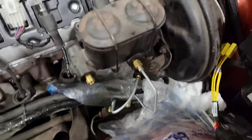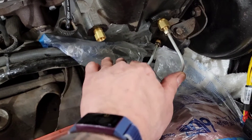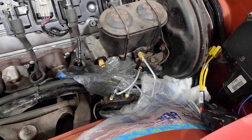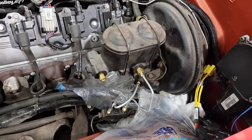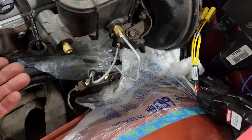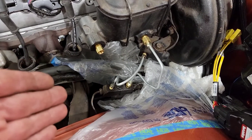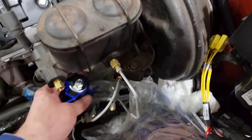After a bunch of deliberation I ended up just putting these two back pretty much in the same spot, but cutting out a bit of line on both of them — I think it'll be fine. I would prefer a loop, but I'm going to do something a little different because I got to put a rear end in this at some point, so I'll be changing master cylinders. This is actually the proportioning valve — wait, I think I misspoke — that's just a distribution block but with the brake switch in the middle of it. We'll actually be plugging off one of those ports and putting in the roll control here.